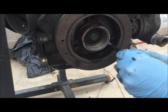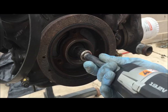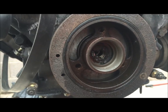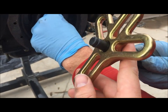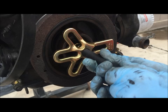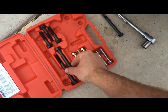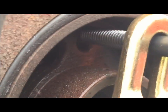We're going to thread these in and put the puller on it. Using the 18 millimeter socket, we're going to remove the center bolt in the crank — that had a washer around it, so that was also holding this pulley in place. Now we can use our puller set. We've taken the chicken foot-looking thing and put it on the big threaded rod it comes with, and we're going to put our cap on the very front to help center it. We'll line up the crank pulley threads with the provided rods in the kit so each of them goes into the balancer where the threads are.